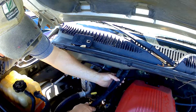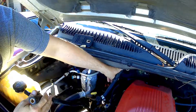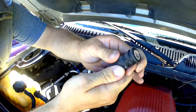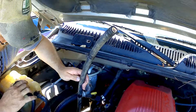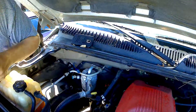I thought the heater core went, but as you can see it wasn't the heater core — it's this connection right here. It broke off right at the base of the hose, and there's about that much of the inlet still stuck in the hose. Thankfully I was able to bypass the hose off of the cooling tank and finish my day. It's been running fine for two weeks, so that's a good fix.